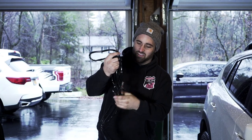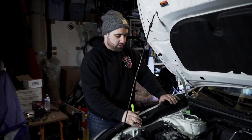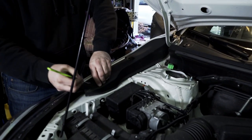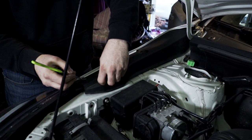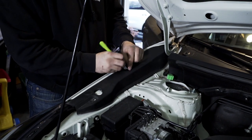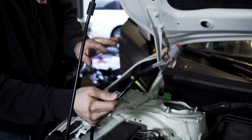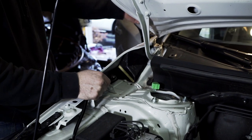I got the heavy-duty wiring harness and it is definitely heavy duty. For installing the harness on the passenger side, pull these little fender caps off — it's two little pop snaps — and then you can pull this panel off and start running the wire through so it comes out the other side.